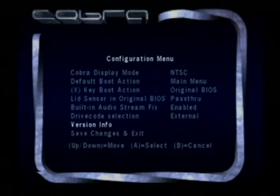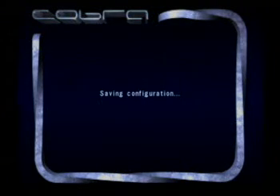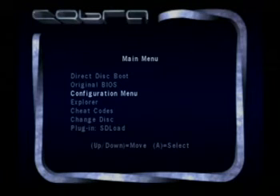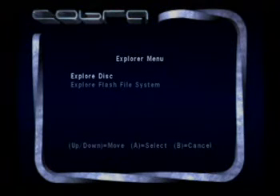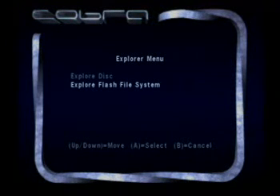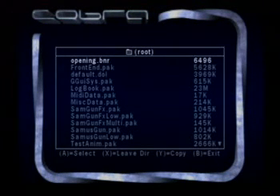You can also check the version information of your console. The Disk Explorer is just that — it is just an Explorer. I have recently upgraded to the Viper Extreme chip, so you might not see the Explore Flash file system. The Viper GameCube Extreme has, I do believe, 16 megs of onboard Flash file system, which means you can actually put DOL files and other executable homebrew on the actual chip itself. Otherwise you'll just be stuck with the Explore Disk function, which will let you explore the data that's on the disk.